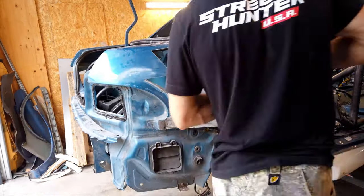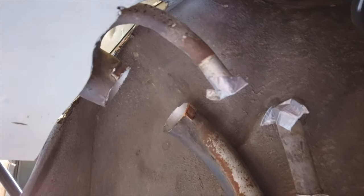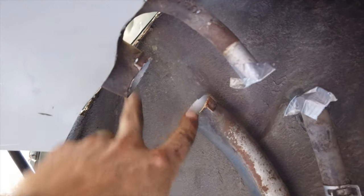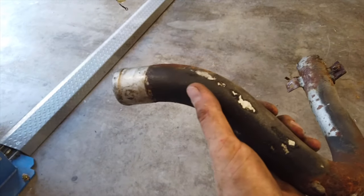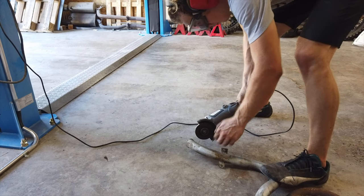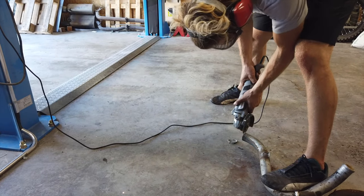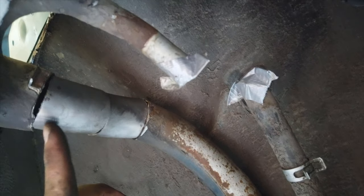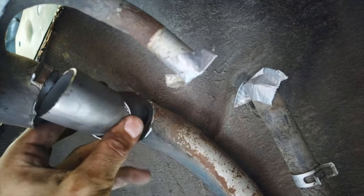Now you can really see the problem here. By moving out the panel, we actually created this gap here, which we can fill by using a rubber coupler or we can just weld a piece of pipe right in between here, which I'm going to do. I grabbed the other filler neck from my other car — it's a little bit rusty, but I think I can use the top section. I'm going to cut it and try to weld it in that space over there. I've got two pieces of tube right there making the exact bend that I need. All I need to do now is clean up the edges, close up some of the gaps, and tack them in place.